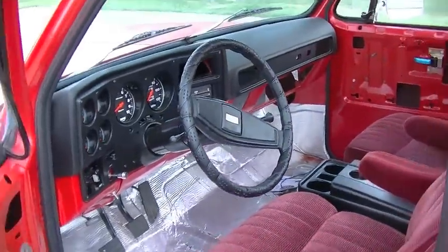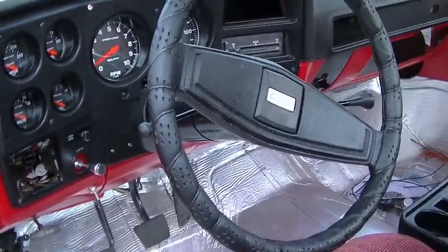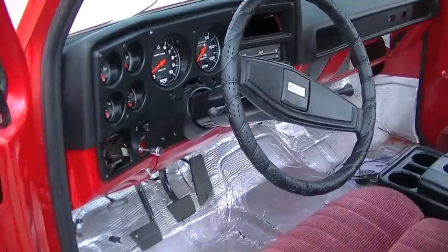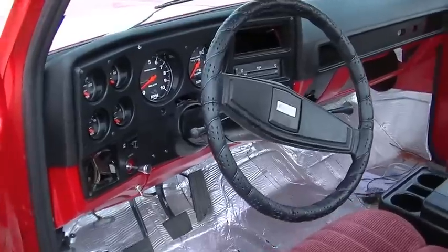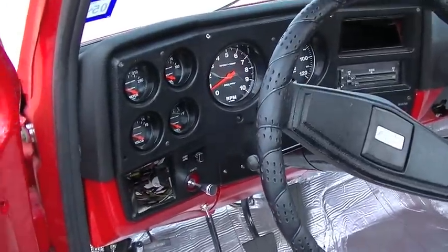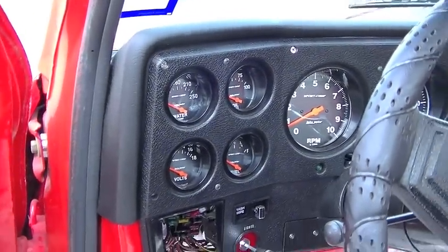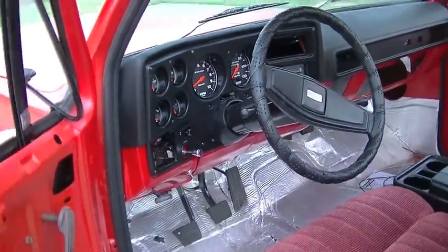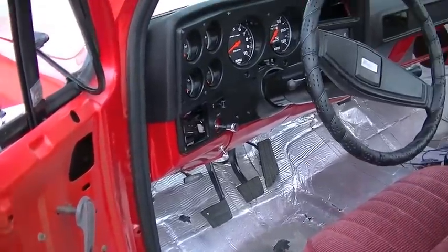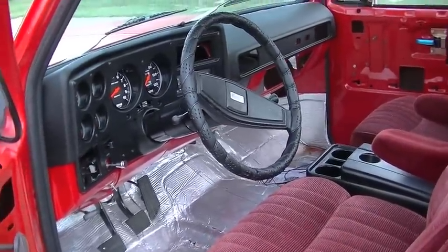The dash is done. One thing I'd like to note is it's gotten pretty warm out — crowding 100 degrees here in Dallas, Texas — and I've been driving this around and I'm not having any overheating issues. It gets up to 200, then the thermostat will open, the fan will come on, and it'll drop back down to 180, just fluctuating between 200 and 180. So I'm really not having any troubles there, which I'm very happy about.